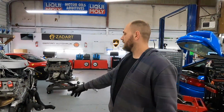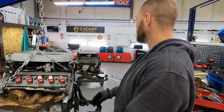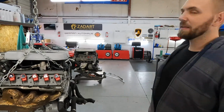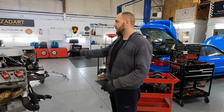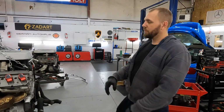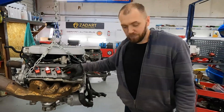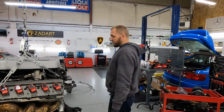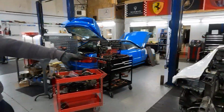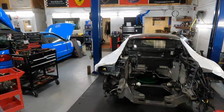Some stuff like a little bit different hoses. We make sure the engine looks exactly the same. Then we remove it from this shell. Headers there, left and right. New gasket, we retorque. Now it's a good time to replace spark plugs, of course. We did it. And a few hoses, and I want to clean it and start installing the engine back.